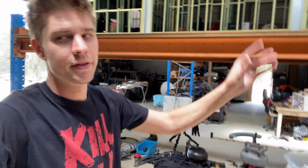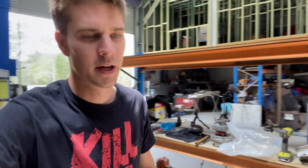But what I've decided to do, even though there's not really any oil starvation issues, is this: the oil test I did on this car, probably two episodes ago, still just doesn't seem like enough oil is coming through that feed with the turbo hooked up. I reckon there is too much restriction. So I'm going to decide not to run restrictors on this turbo this time.